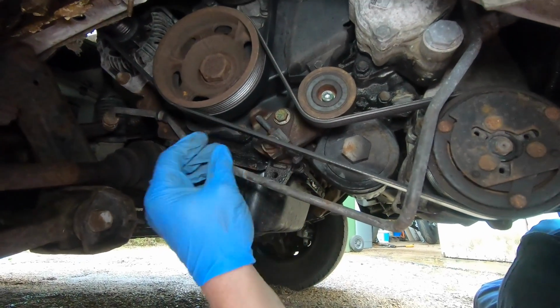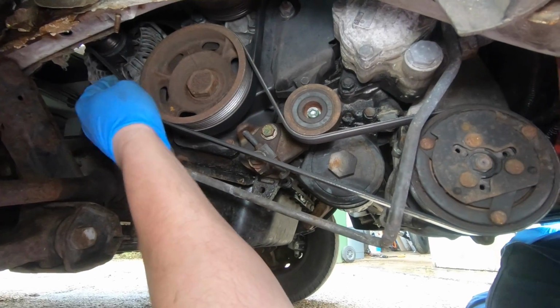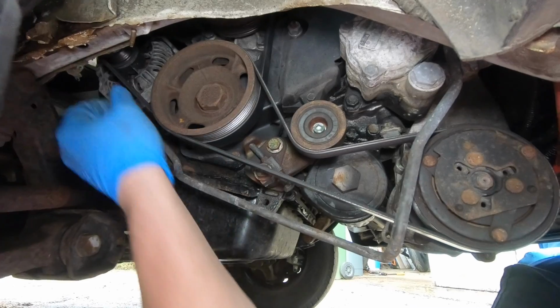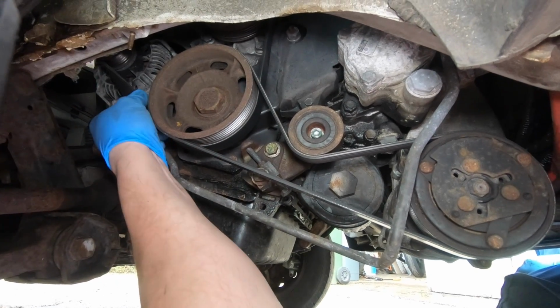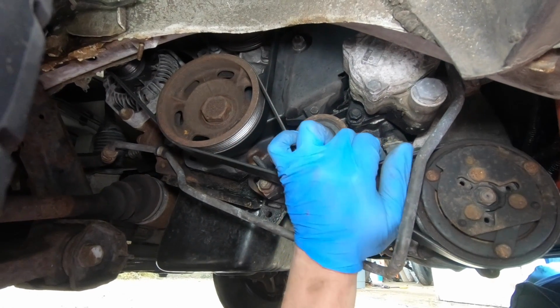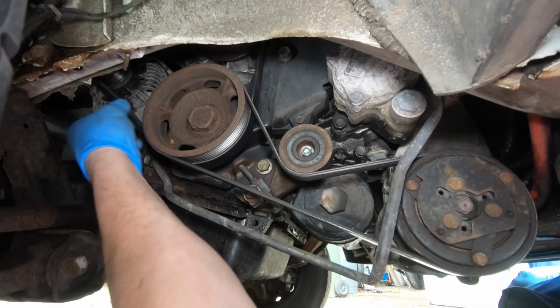Yeah, they were changed at the last service. Well, they said that. But they weren't changed properly, because that wasn't tight. I think it was perfect when we started off, and then the squeaking got worse and worse. So I think the belt is probably stretched or bedded in, and it just needed adjusting. So we'll tighten this one up a little bit, but I think he's all good.